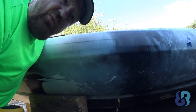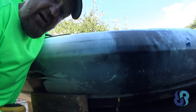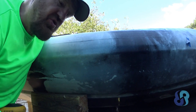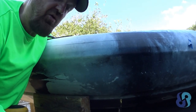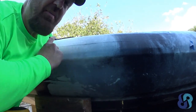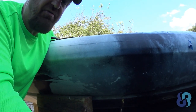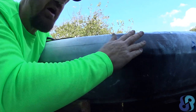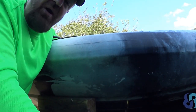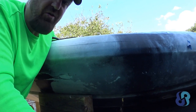One thing I was going to say about that 150 grit — 40, 60, 80 grit, that kind of stuff, if you've ever used it you know it will eat through things real quick. It'll go through Bondo body filler real fast, so I wouldn't recommend trying that on your kayak. It would chew it up fast, make huge sand lines, and if you're not paying attention you could make yourself a hole. That's why I said 150 and 220 — and 220 is doing a great job.